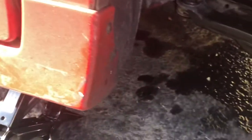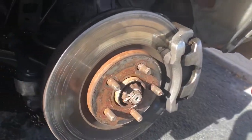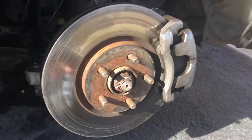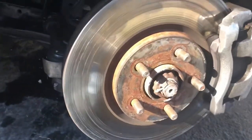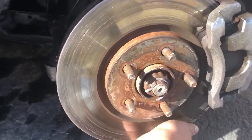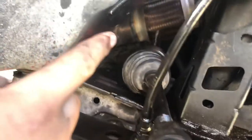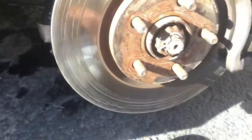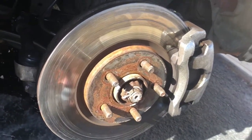What we're looking at — we were driving around and our issue today is I've recently been noticing there's a weird wobble going on with the front end of this car. I thought it was just my brakes giving me issues because I noticed it started scratching up after I just replaced these things. Come to find out, I think I have a wheel bearing going out, because on top of that, there's the main line right there for the rack and pinion — I thought it just busted because it just pooped oil everywhere.